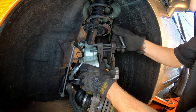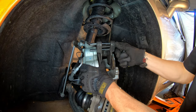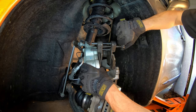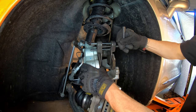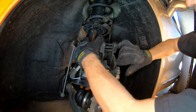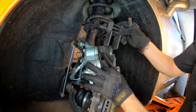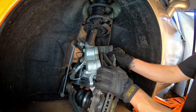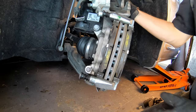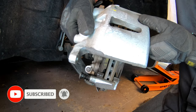There's another type of compressor — you put a brake pad on both sides and it pushes the pistons in simultaneously. This one works a lot more efficiently. If you have a dual-piston caliper setup with pistons on both sides, this is the one you have to use, so you can do a lot more brake jobs with it. Links in the description if you need them. Either one works — just get the job done.